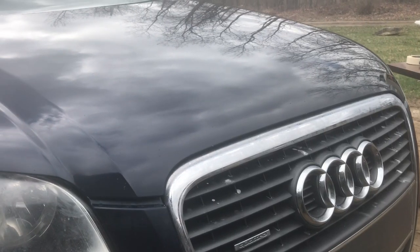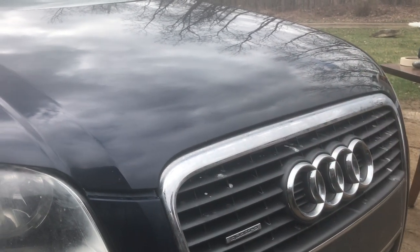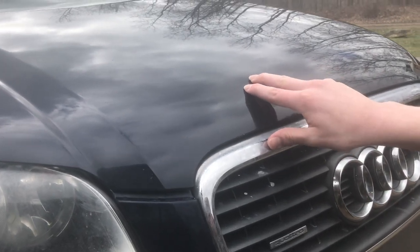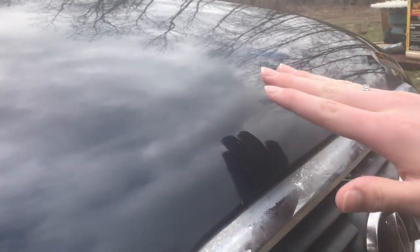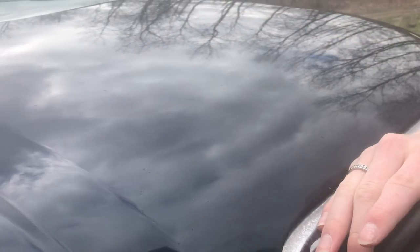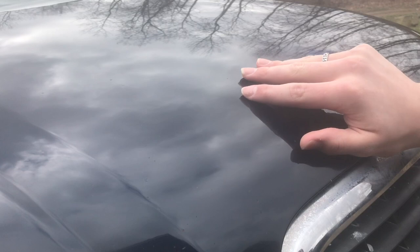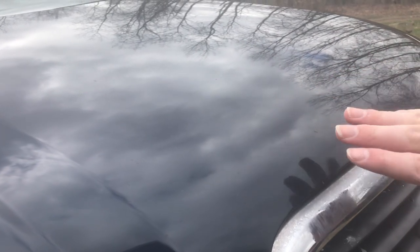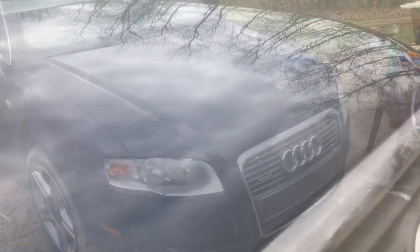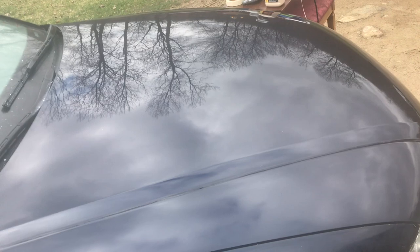This looks really nice. You can see the even reflection going on the hood — I'm happy with how it turned out. Now on this side of the hood, maybe if I spent a little bit more time with 3,000 grit — if you can look at it close enough, I don't know if you can see it on camera, but there are these little streaks running up, and I'm guessing those are from whenever I was sanding and flattening the paint. It's a lot smoother than what it was, but those little streaks are a little bit visible. They kind of look like water streaks, but I think it's okay. If I wanted, I could go back with 3,000 or with compound and clean that up, but they're just barely noticeable. That's a huge improvement from what it was.